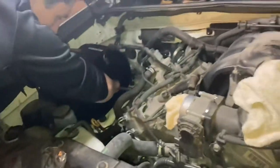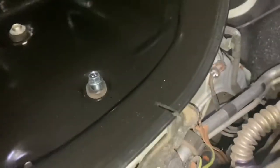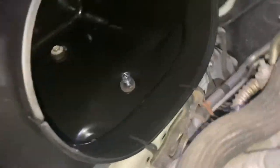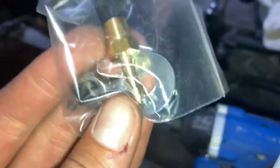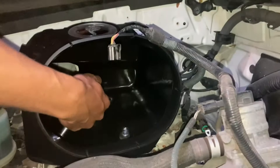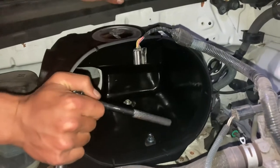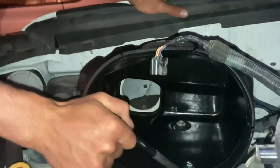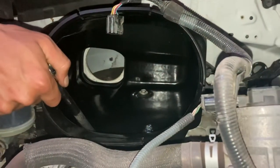Now we are going to use the supplied 12mm screw in the close one towards the engine — the back right rear. After that, use the provided nut with the washer on the screw that's sticking out that we installed by hand. We got those screwed in — push the box a little towards the passenger seat to fit the screw in — and then place the 13mm washer here on top with the 13mm bolt.